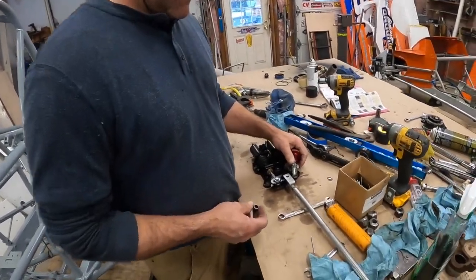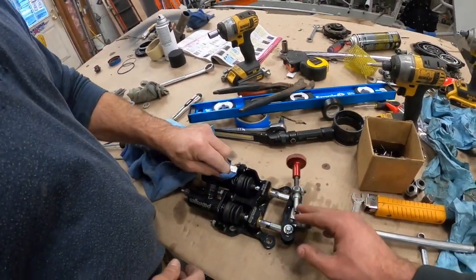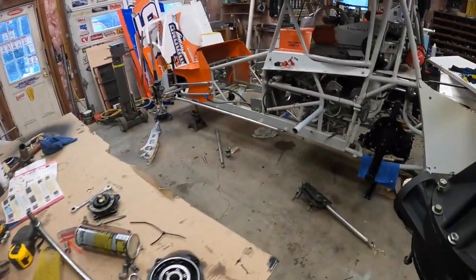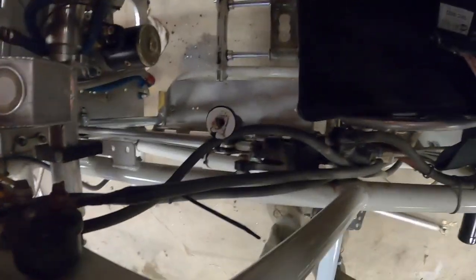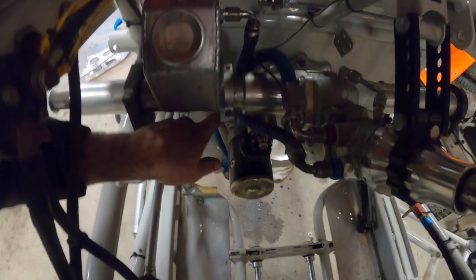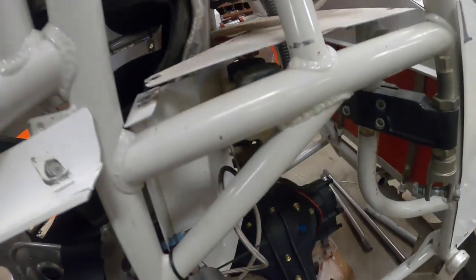So yeah, and this thing is unique. Bicknell makes this product here because our brake bias adjusters go on the sides. We're in a pavement late model, modified, dirt late model, all the pedals are forward. So you can see in my car it's still in there, and I have the exact same one. In the cockpit, this is the knob right here, so it's actually on the side. So all this goes in the corner, instead of with like the pavement modified, the pedals are out front, in the masters and all that, where we have our masters here and our tanks are all the way back here.